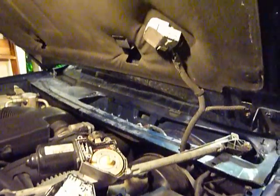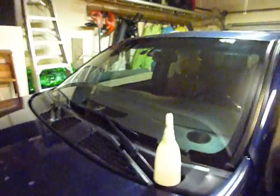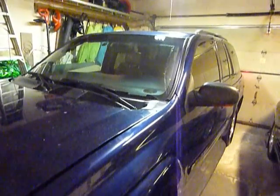Hopefully these move up and down very smooth, not choppy and stopping halfway down like they used to. So that's it — really pretty simple fix. We got her buttoned up again; that literally took five minutes. Here's the test — I'm going to spray up here with a little bit of water. Let's see if it's smooth. Look at that. Beautiful. Just like new. So if you have jumping wipers or those that stop, take about an hour — that's about all this took, maybe even a little less than that because I was filming. Clean off that gear, that's it. So that concludes the video. I hope you find this useful. Don't go spend $150 or $200 on a new motor — it's not needed. Just follow this simple procedure and the wipers are good as new.